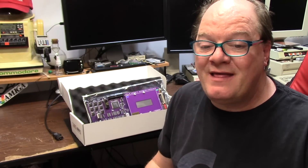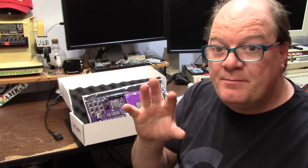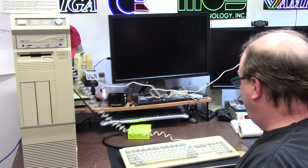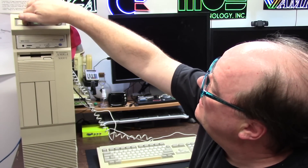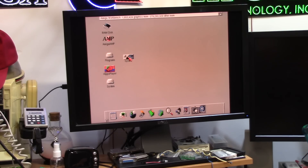We're going to use the 3000 Tower and do some basic benchmarks on its internal SCSI bus right now. It's rocking a Zulu SCSI — the blue card V1.1, not a blue SCSI, it's a blue-colored Zulu. This is the Amiga with a 68040 in it. We are running currently in NTSC high-res laced 8-color mode.